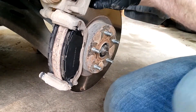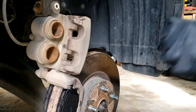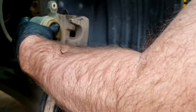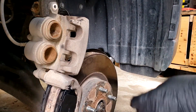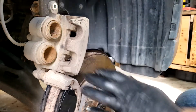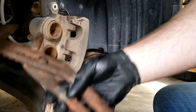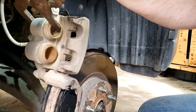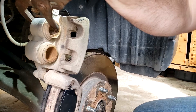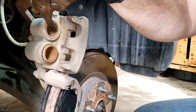And I'm not kidding — that's it. Oh, I am kidding. We need to make room for these thicker brake pads. So to do that, I want to avoid getting grease all over the caliper, but I'm going to use these vice grips — these giant ones — and I'm just going to push the piston in.